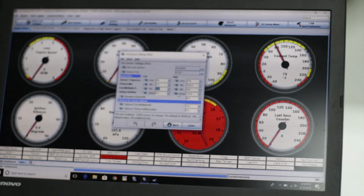But anyways, generally with E85, you have to add timing. That's actually degrees, it's not a percentage. So at the top end of the table, at 100% ethanol, I'd probably add, say, 5 degrees more timing on top of everything. Maybe more, I don't know. Like I said, I'll have to sit and do some research and figure out exactly what I should be running there.